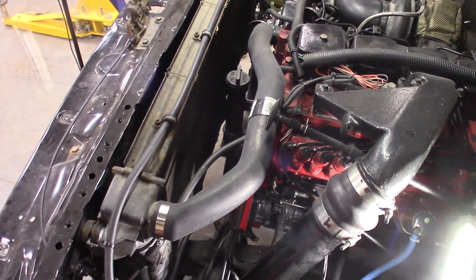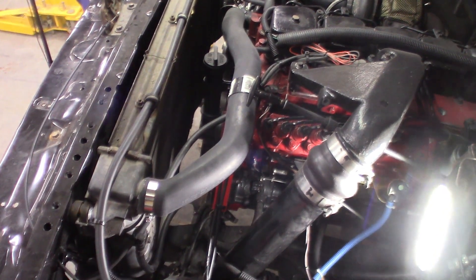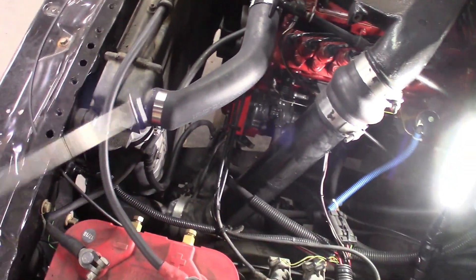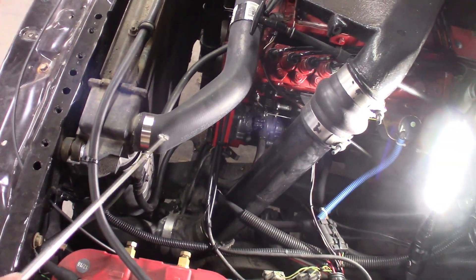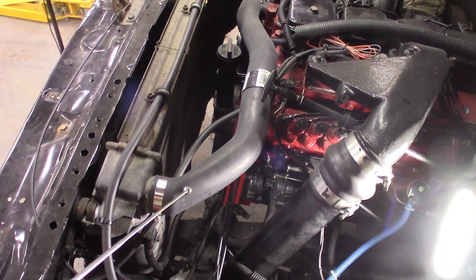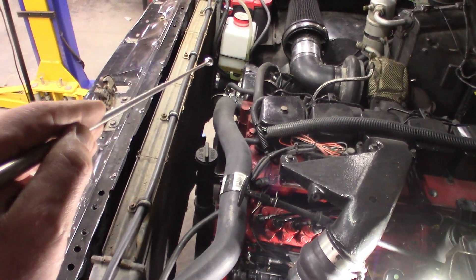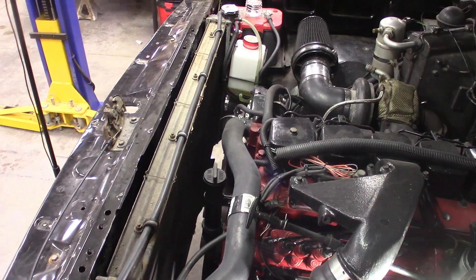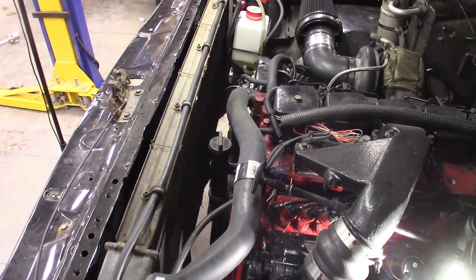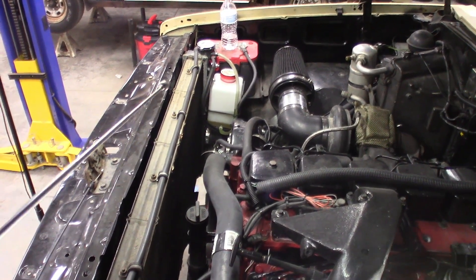Like I said, on this truck we do not have room for a mechanical fan. We were, however, able to use the factory upper hose off of a 90-95 Dodge Ram. We used the factory lower hose as well. Running the dual batteries and the Dodge radiator, we had no room for either style factory overflow tank. So we just picked up a cheapie at the auto parts store and mounted it right there.